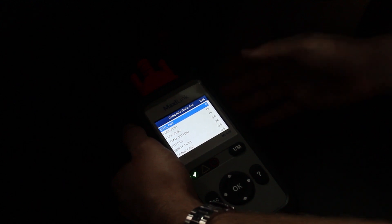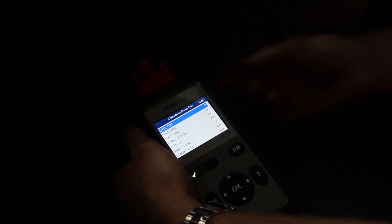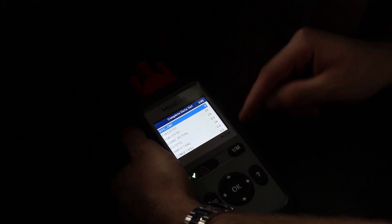From there you have all your options: read codes — there are none on this vehicle; erase codes — again none. Live data is really useful — it communicates with the ECU and gives you live readouts for things like mass airflow through the actual sensor, throttle position, accelerator pedal position, and all sorts of other things. This is great if you're diagnosing an issue and want to check a sensor's feedback to the ECU. For example, if you think an O2 sensor is bad, you can check if it's reporting proper data, which tells you whether the sensor itself is bad or if something in between — like a wiring harness — has failed.